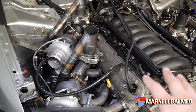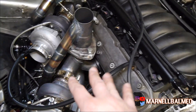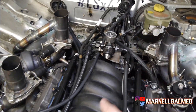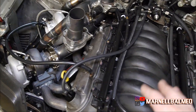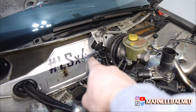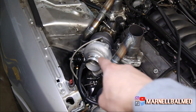Ignore this — it's just for measuring pressure on the crankcase. The setup is a bit sketch but it's the best I could come up with given the time I have. Essentially when the car is cruising or idling it will pull vacuum this way. Under boost, that path shuts off, and any crankcase pressure will vent out through the one-way valve. In theory this side should also pull into the turbo.